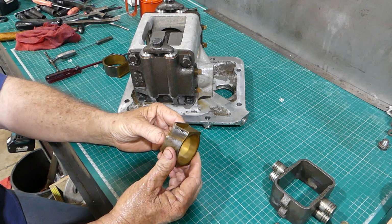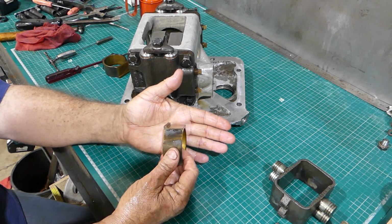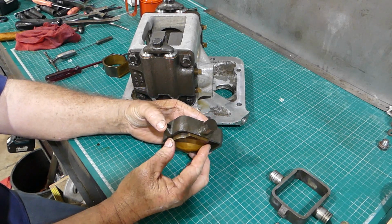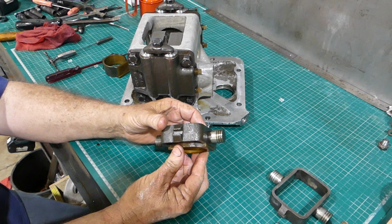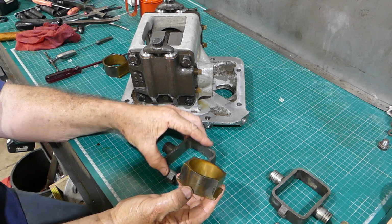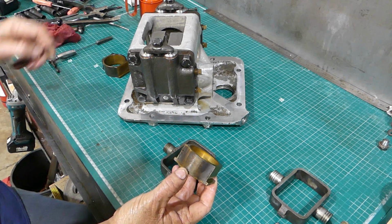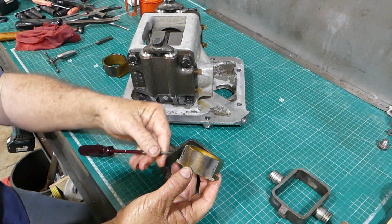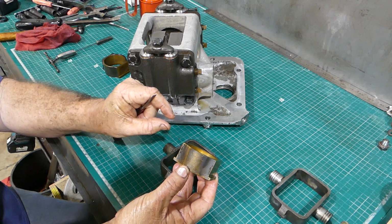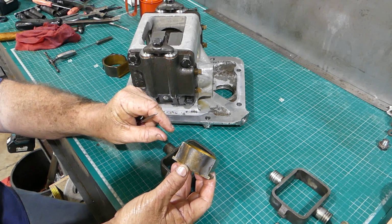Well, on these rubbing blocks here, you can see this little right angle here. Where this sits up into the pump and rubs back and forth along the back there, that's got to be a nice flat smooth surface. Now on the new ones, the Sparex ones, when they'd machined them, the outside diameter was correct, but the inside diameter had a very slight chamfer in there. And over the whole assembly, it made it a little under 20 thou, about 18 thousandths of an inch.